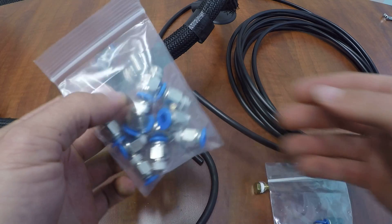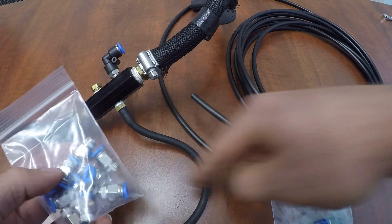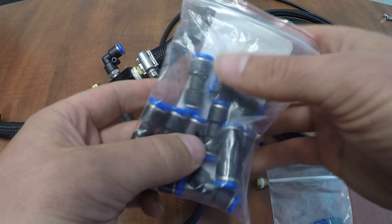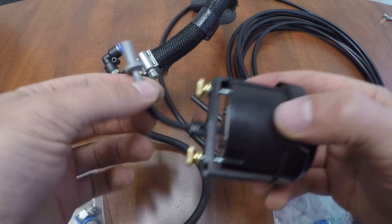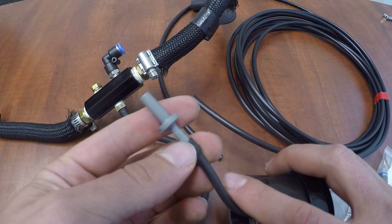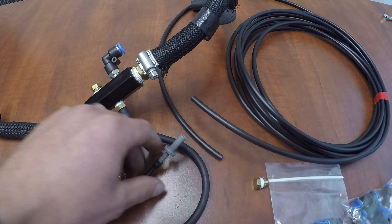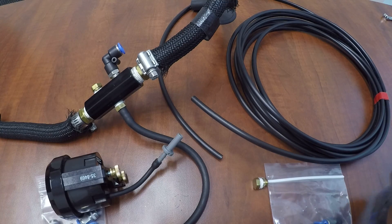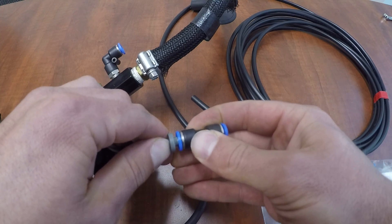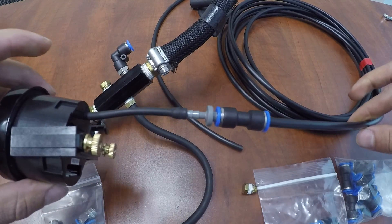I've also got straight fittings because the bypass valve on this uses the same fitting on the other end, so instead of the cheap hose I'm going to use these to make it all super trick. The last thing to show you is these unions. On my boost gauge, it had a rubber hose, so I bought this little adapter fitting that goes from a barb fitting to these push-lock fittings. We'll take that adapter, then use a union to connect and continue on with the push-lock line.